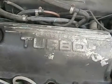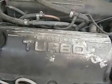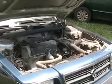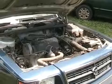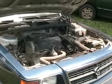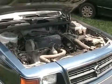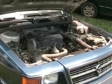Now let's talk about forced air induction systems when we're talking about air induction in tuning cars for flow. Turbo cars and supercharged engines are a compressor. They are blowing compressed air into the intake manifold system, runners and plenum, whatever. And so when the intake valve opens, a charge of pre-compressed air that's way above atmospheric pressure rushes in unhindered.